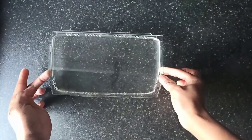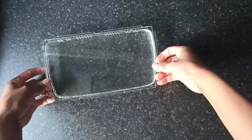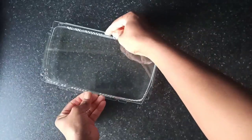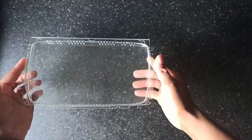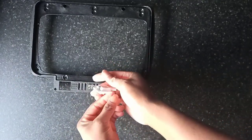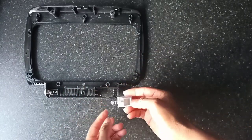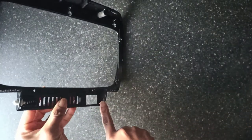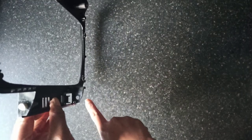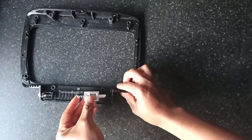The glass shield is just clipped onto the plastic part just like this. It's quite easy, it just needs a gentle push and that is clipped in. The next step is to replace the attachment with which the door can be removed from the air fryer. To do this, you insert the pointed end into the space in the door just like that, while the end with the spring goes in the other direction.